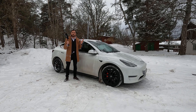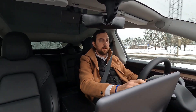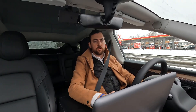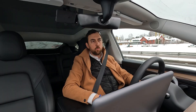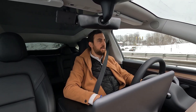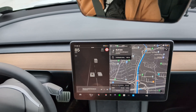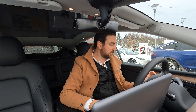We're going to drive to the charger — approximately 30 minutes, same as last time — using the exact same charger, charging from 10 to 80 percent. Approaching the charge station, the battery is still not hot; there's some kind of limited range — about 80 percent of full range and 70 percent of full power output. The battery pack still isn't warmed up after almost half an hour of driving, so it will probably stay that way since I'm not using preheat.